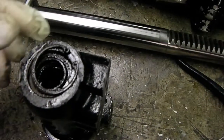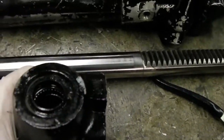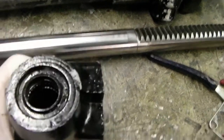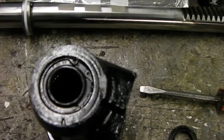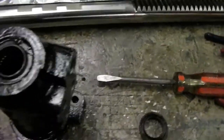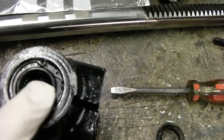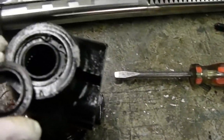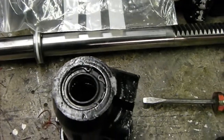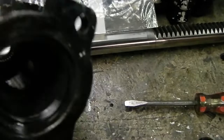At the top of the tower, I've done the circlip and now there's a seal to remove. There's also a roller bearing underneath — on this one it's really good, but you can replace that roller bearing if need be. The new seal is fitted — the original seal was a one-piece but the new seal came as two pieces: the actual seal and then a hardened rubber top cap. It's exactly the same design, just a two-part seal. Now I can put the shaft back into the actual tower, and the tower is rebuilt.